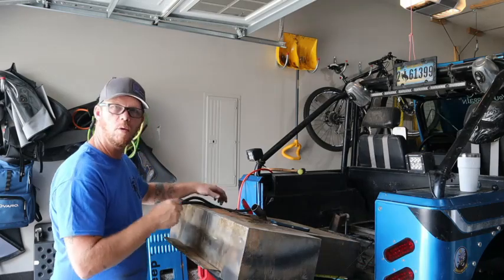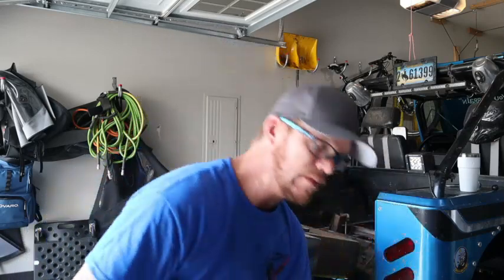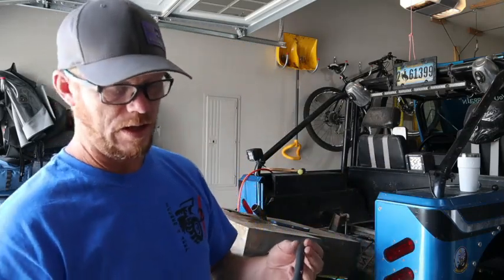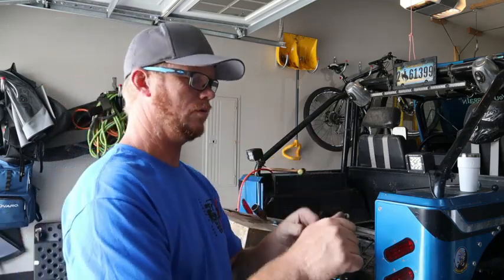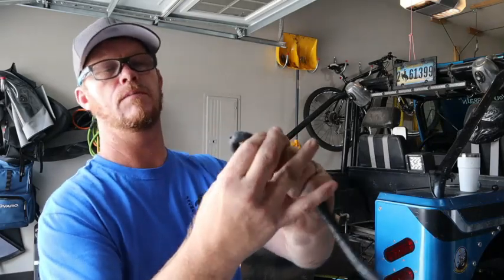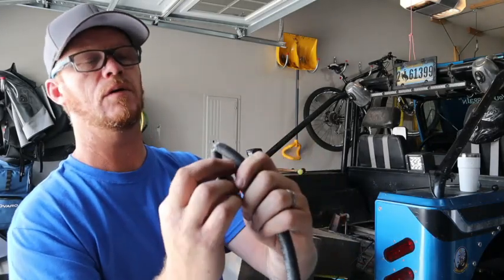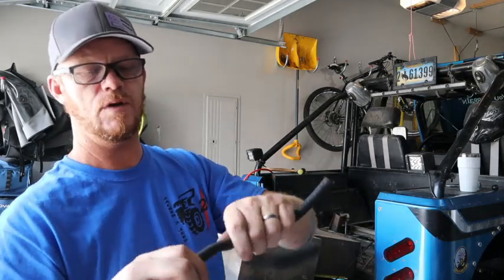The other thing you want to watch when you're buying a used Jeep is the age of the hose. Now this says 5/8/97, so this is an old hose. You can tell I can just bend it and it'll pop right. Look at that, it breaks right in half. It's also cracked on the inside. This will just break all the way across.